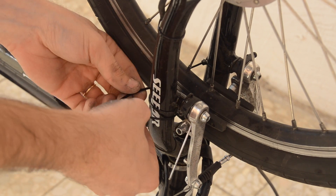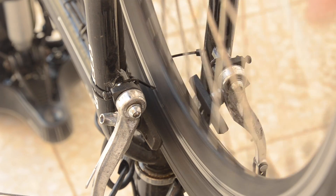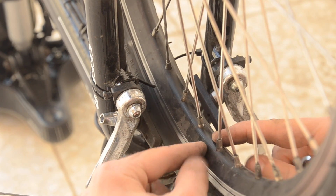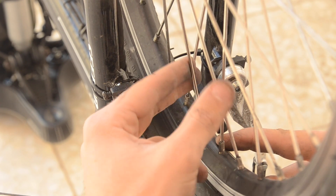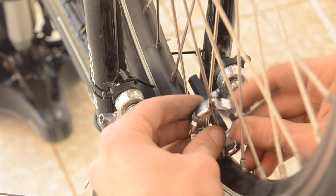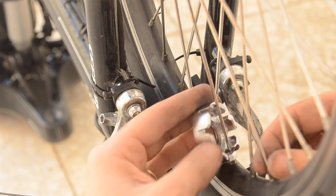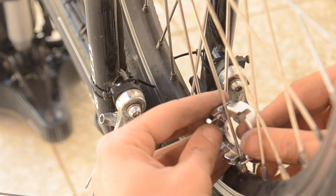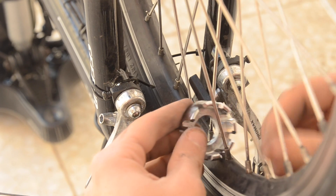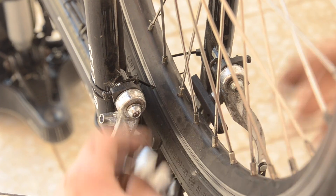Now that we've made some adjustments on one side of the wheel, we're going to come around to the other side and do that same trick with the cable tie. I'm going to look on this side of the wheel for the area that seems to be the farthest away from the new cable tie. It seems to be about here — about these two spokes. I'm going to tighten five spokes on this side. Notice I'm doing spokes that go to the other side of the hub, because now I'm trying to pull it to the other side of the bike. I'm tightening these about half a turn or so. And now if I bring in for the close look, this is actually quite good — less than a millimeter of side-to-side out-of-trueness, which is quite good.